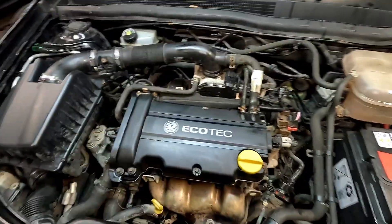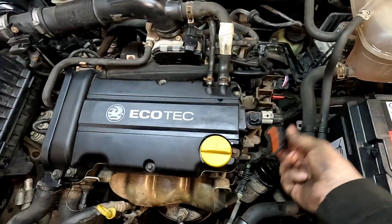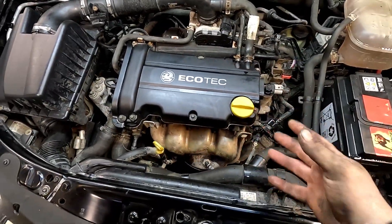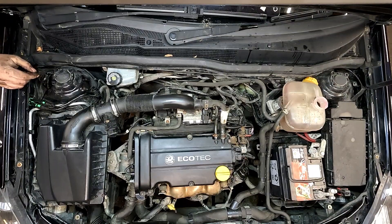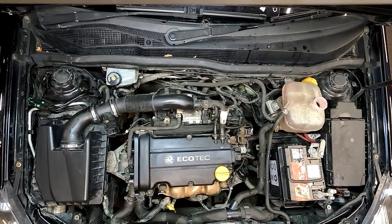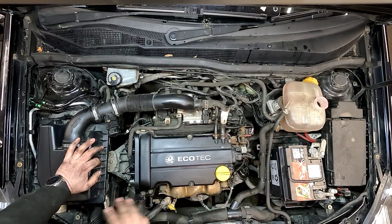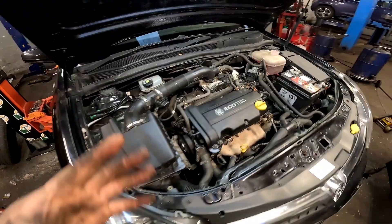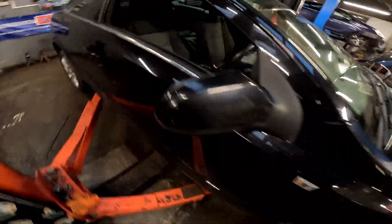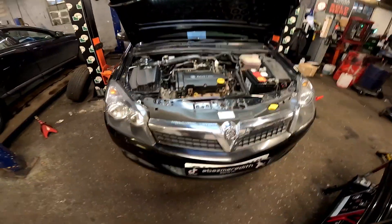And there you have it - that is all back together. We've put a fresh oil filter and fresh oil in it, and some fresh coolant. Before giving it a big start, unplug the coil pack and wind it over for about 30-40 seconds to get the oil pressure up. Now we've got the coil pack plug back in, let's give it a big start. That car is now up to temperature, coolant is nice and hot at normal operating temperature, and it is perfect. We've reset all the adaptions and we've got no fault codes whatsoever. Hope you've all enjoyed watching it.